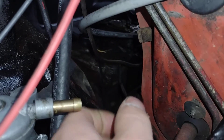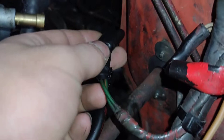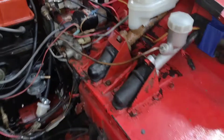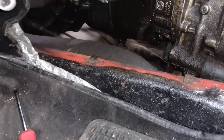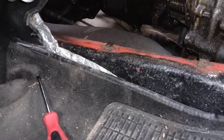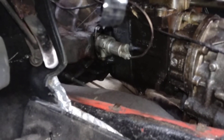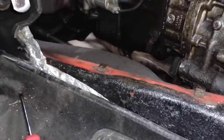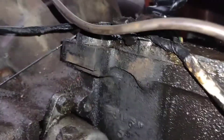I'm going to get in the car and show you where both wires go. One's a power, one's kind of like a ground. The easiest way to get to it is just take your tunnel out. You can drop the tranny, but it's hard to do from the bottom in these cars. You're pretty much either taking the motor out or pulling the tunnel — a lot of guys like me will just pull the tunnel, especially for something small like this.